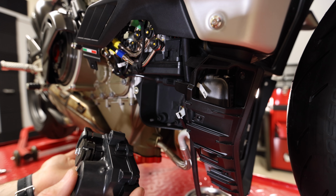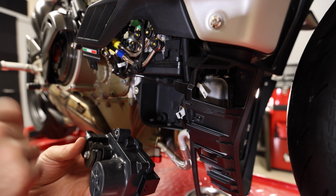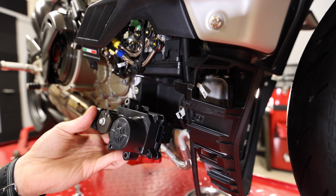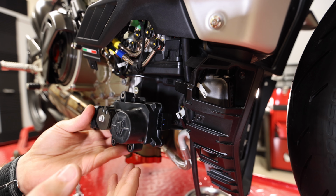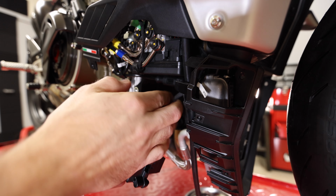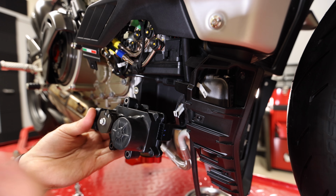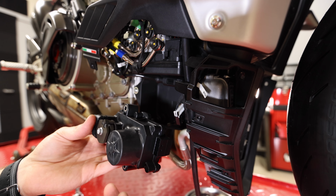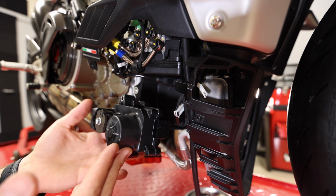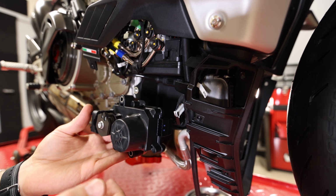And then basically what's gonna happen is through either ECU tuning, flash, or a servo solution, you can do a servo eliminator kit that will basically just be plug and play. Before you get that done, if you eliminate this servo, you're probably gonna get some check engine lights, that kind of thing. But from there, you can just find that servo eliminator solution and be done with it.